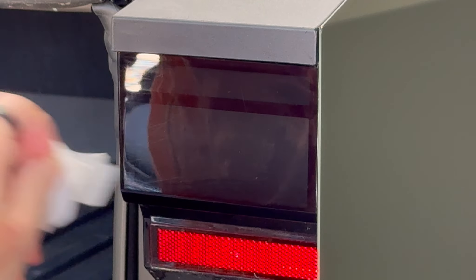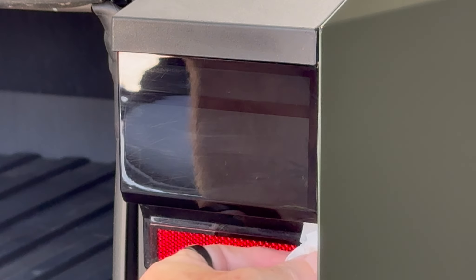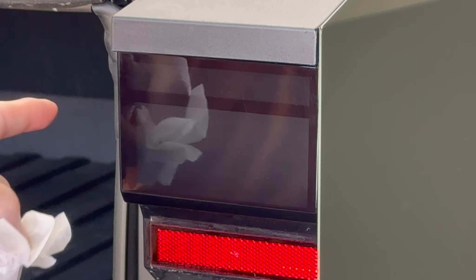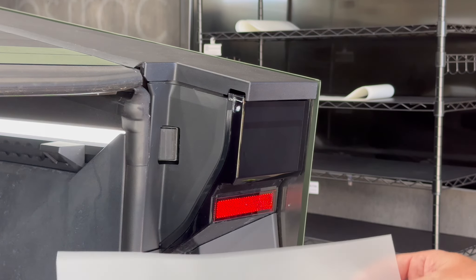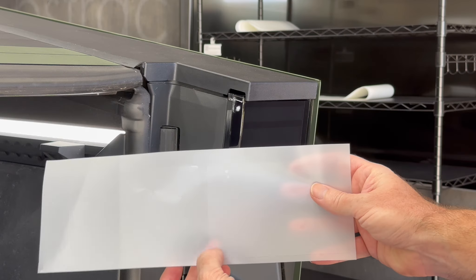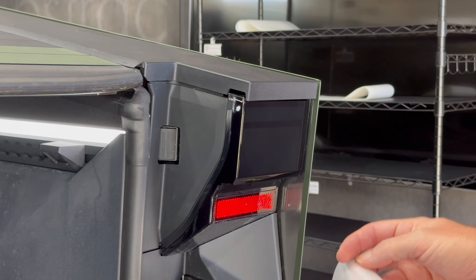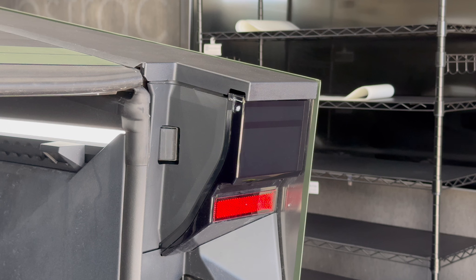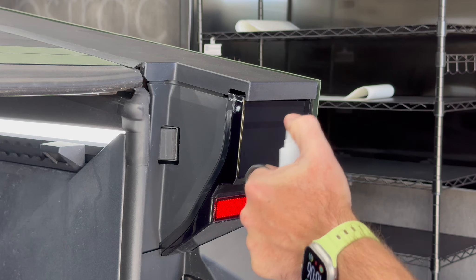The truck's pretty clean at the moment. If yours is not, just make sure you clean the area around the light as well, just in case the PPF makes contact. It's not such an issue for the side lights but for the long piece you want to pay attention to it. These are the two pieces — the side with the little Pac-Man mouth cutout is what gets wrapped around the edge. We're going to choose the right side piece. Spray the target area, be generous, spray your fingers.